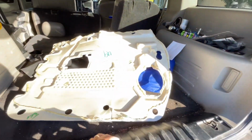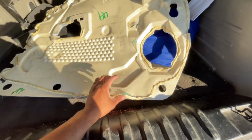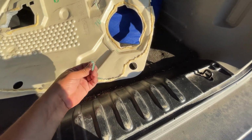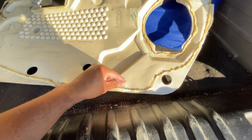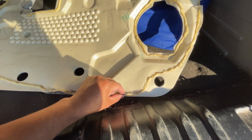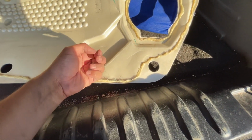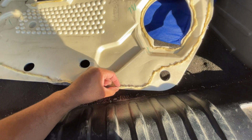So I'm just gonna throw these back here again. If you suspect that there's been already a replacement of your previous window, be careful, because this could happen. This is a common thing when the window was broken into and the shop that replaced it didn't do a good job, or didn't take this thing all the way out, and they leave glass pieces in there. And also use gloves.